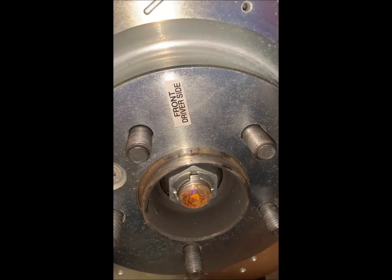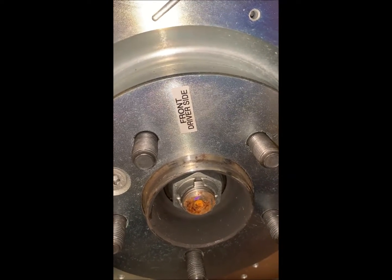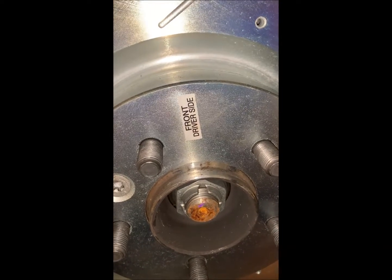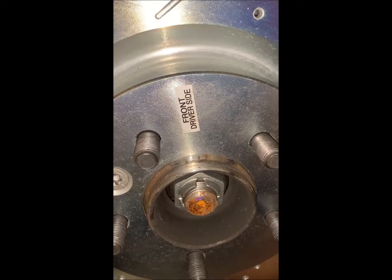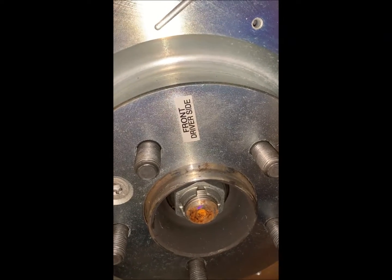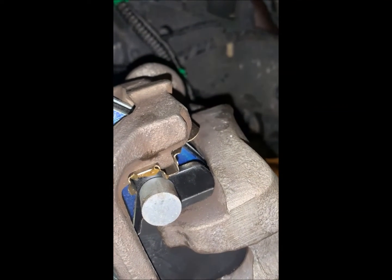Okay, well, everything is back together here on the driver's side, and the last thing we need to do is replace the wear sensor. Remember, the wear sensor lives on the driver's front and passenger rear wheels. So same as the rear one, at this point in time we cannot connect it to the caliper because one of the clips goes over the bleed port and we still need to bleed the brakes. So we can replace the rest of the cable and leave that little bit for later.